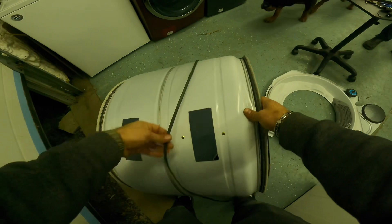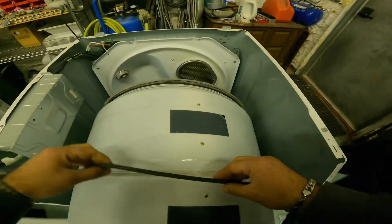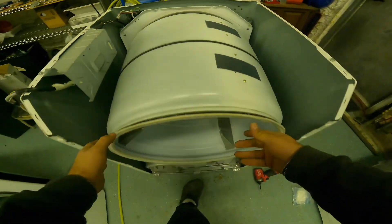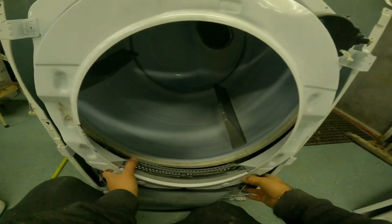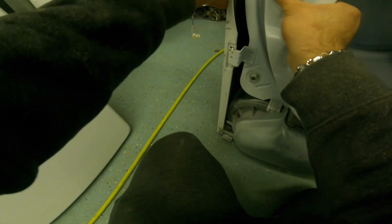Now we're pretty much ready to assemble it back together. I like to use this little trick — I put the belt on the drum first so it can help me carry it in. I'm running through the belt to make sure it's all in the right direction and there are no twists in it. Next, make sure you align the drum right in between the rollers and make sure it's sitting correctly with no space or gap between the back and the drum. Over here I'm installing the belt on the motor and the tensioner blindly — if you struggle with this, leave a comment and I'll make a detailed video. I like to lift the drum from the bottom to align everything in place. Next, align all four tabs all around — it's a little frustrating at times, but I do it by myself and use my knee to help.